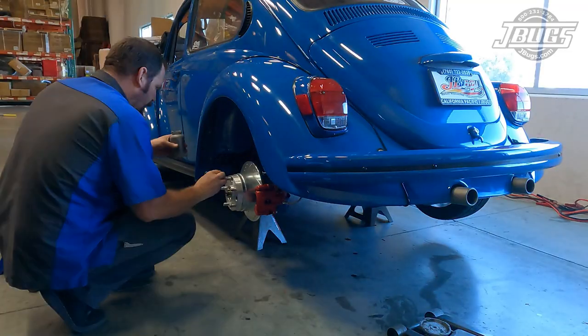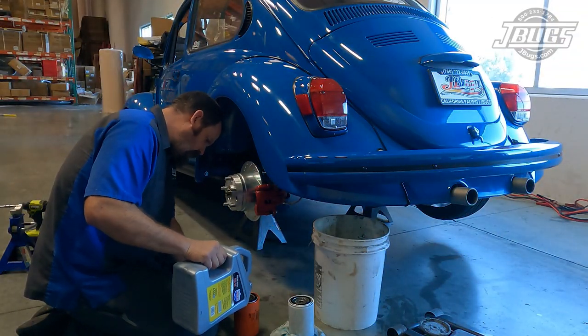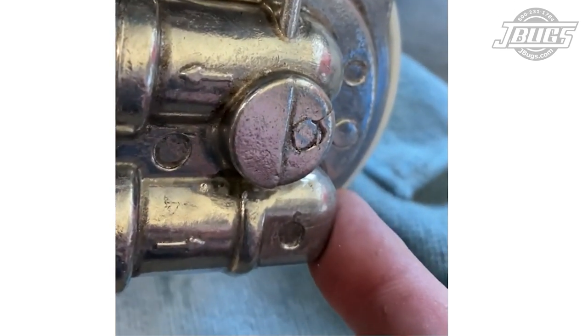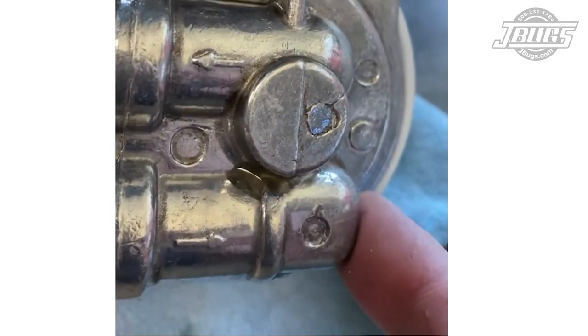While we're driving back and forth, the small oil leak that we'd noticed earlier from the oil filter exposed itself as a large oil leak. We actually swapped our filters when we were adjusting the suspension, trying to take care of the oil leak, and we also checked and rechecked all of our oil lines. After pulling out our hair, scratching our heads, and basically being completely baffled, we felt the top of the filter housing and lo and behold, we found a puddle of oil. We pulled the mount off and with the engine running, we could see that the oil was leaking from the casting of the oil filter housing. A new housing is swapped in and we no longer have an oil leak.